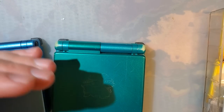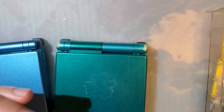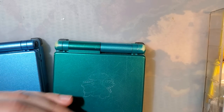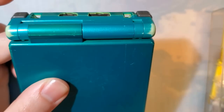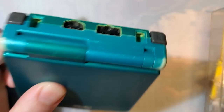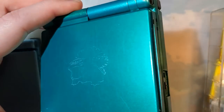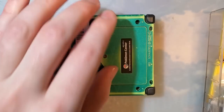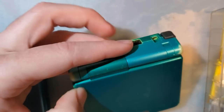When you're doing multiple tests in a row and you measure the capacity of a battery and then you do the runtime on it, and the runtime is less than half of a battery that has less than half the capacity, you know something's wrong. Anyway, I found out that this console no longer consistently fully recharges batteries. And like all the best problems, it is an intermittent problem, so I ended up redoing a lot of the tests by just pulling batteries out of this console, charging them in an external charger, and then popping them back in here. And so that's why you'll see in my data that I'm about to present that there are multiple entries for the same kit on the same console.